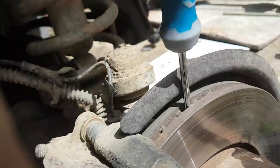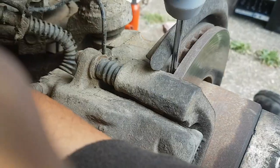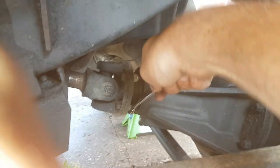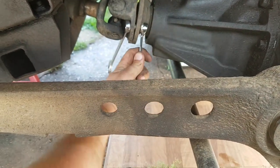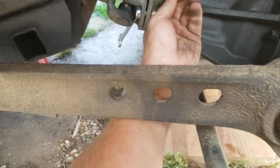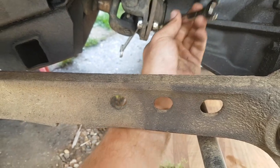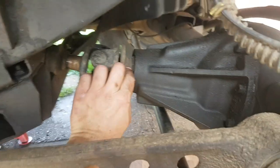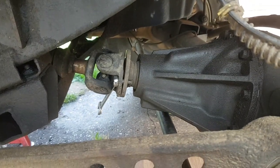Wheels off now. I need to lock the brake disc so that I can undo the diff lantern. As you can see, as I turn it, it's not going to undo — I need two hands. It's a bit easier if I had the prop shaft socket tool, but obviously I don't. Improvise, adapt and overcome — these are two 14mm spanners and it's actually working. We get this off and that'll be the shaft done.